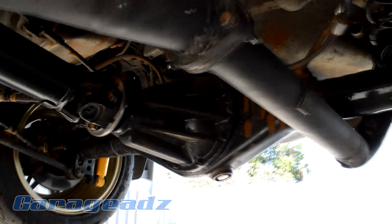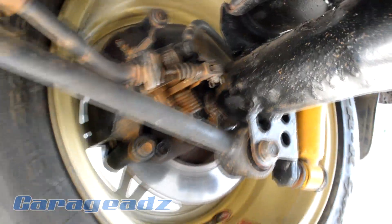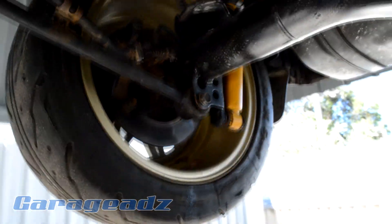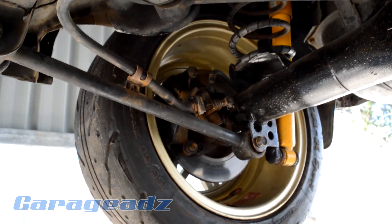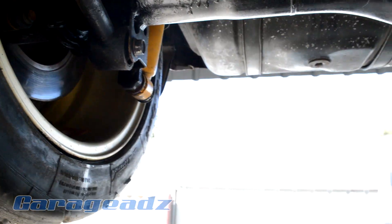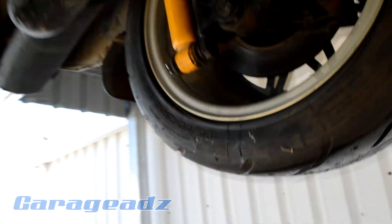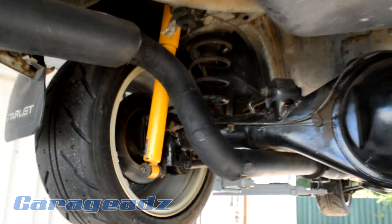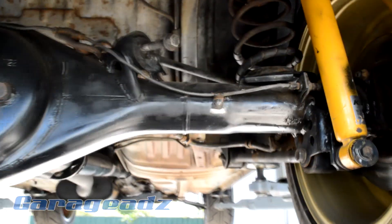To avoid 5,000 questions — this is a Hilux diff. This is originally an RN60 diff, but I've shortened the diff. Currently running SW20, which is MR2 turbo late model calipers and S13 discs. Still 4x114. And AE86 struts in there. Definitely has LSD — quite necessary.